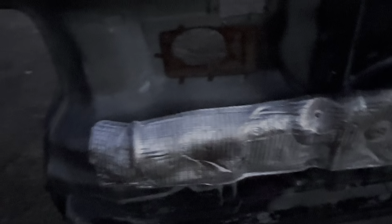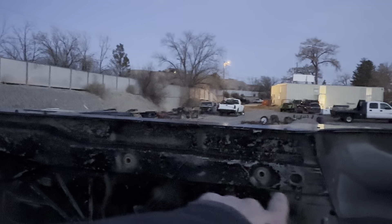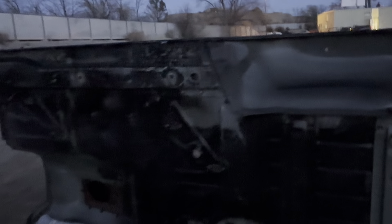Now this is the lower section. For the gentleman looking for this — and anybody else looking for something like it — the bottom of these tubs are the critical parts because they're the hardest to replace, especially since the torque pockets are spot-welded in. If those are collapsed, broken, or cracked, that's usually a tub replacement sign.